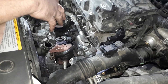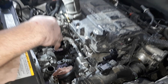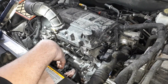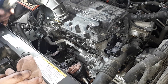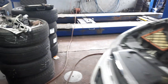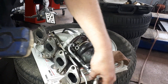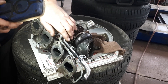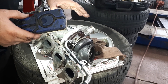This turbo on this vehicle is a compact engine — a whole compact package — and it has a liquid-cooled turbo as well. So we are replacing the coolant hoses on the turbo as well. We have the turbo off the vehicle here with the manifold. This is the turbo here, this is one of the cooler lines that we are changing on it — it's not accessible while the turbo is in place regardless of what you try to take out of the way.